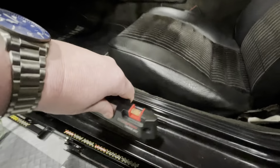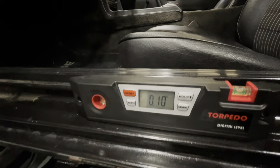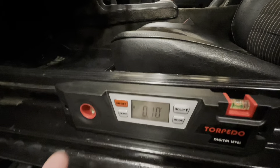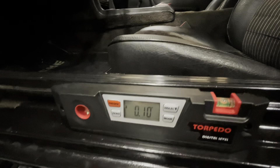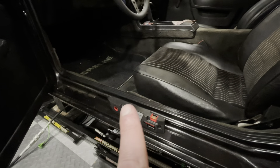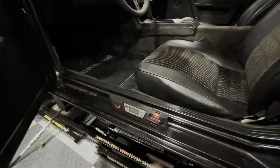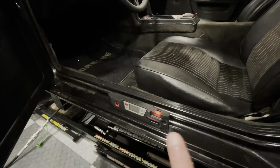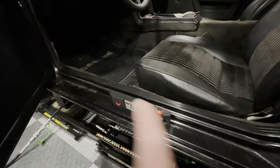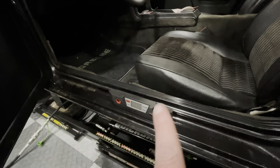Let's pop the level onto the outer sill — and I'm seeing 0.1 degrees, and she's higher at the front. I don't think this is really enough for me to re-index the torsion bars, and the bubble is nicely centered as well. So what I'm going to do is get into the car and see whether that changes the ratio by much. If I then get a lot more angle towards the rear, there's a reason to re-index. But if it's a minimal change, I think we can get what we need using the eccentric adjusters on the torsion plates.